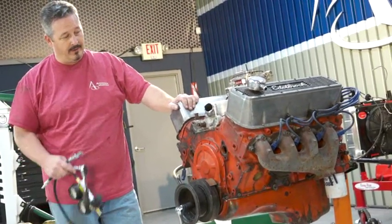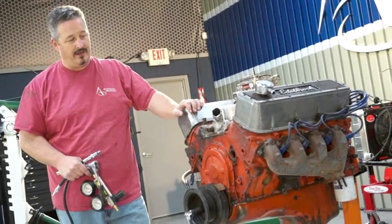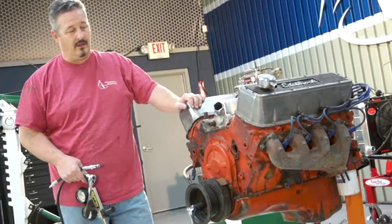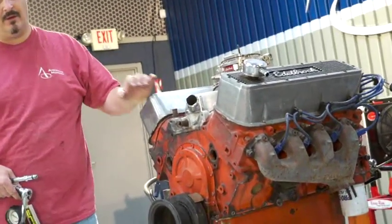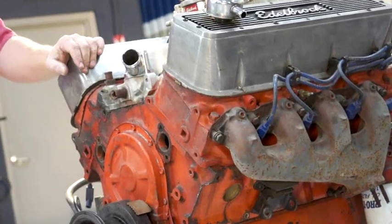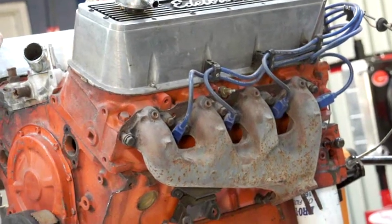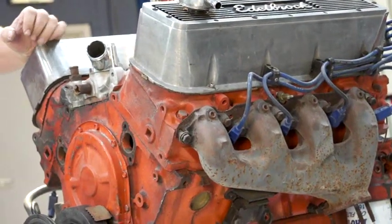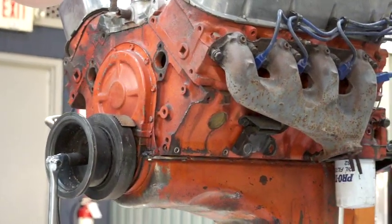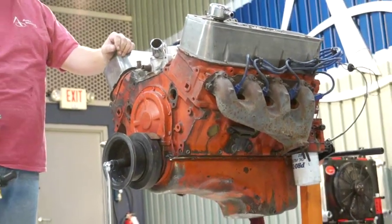What we're going to do now is see what we have. Before we tear the engine apart, I want to see if there are any major issues. So we're going to do a leak-down test on each cylinder. What that means is it will fill the combustion chamber up with air, see how long it takes for it to leak out, and that will tell us if we have damage in the valve area, in the valve train, in the heads, or if we have cracked rings — because you just find out where the air is escaping from, and you'll know what the issue is.